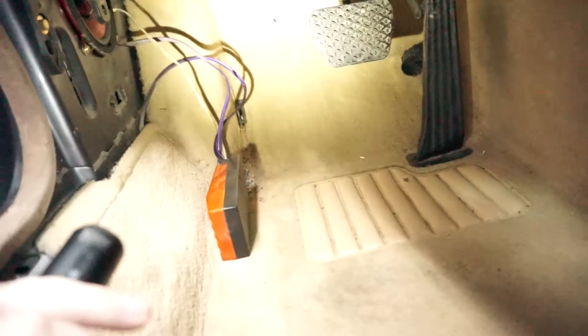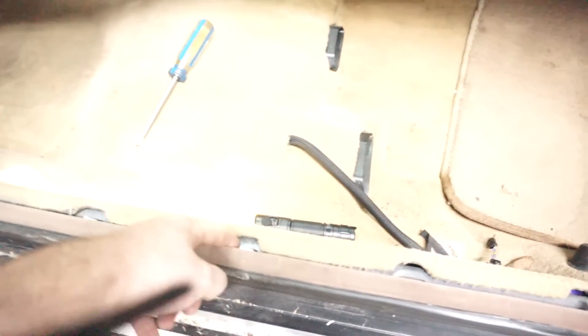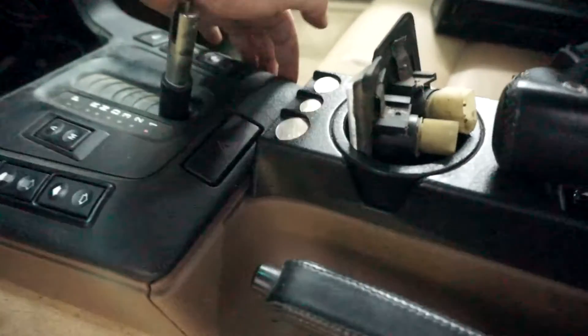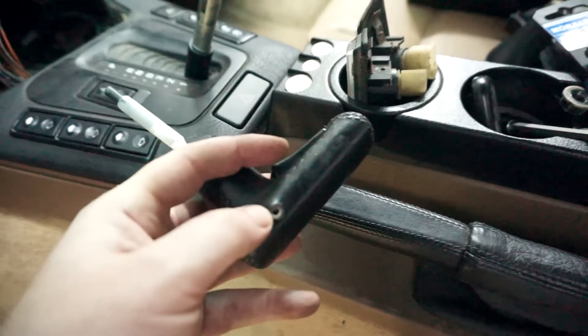Now I get to get on my back with a flashlight and start trying to take the stuff apart. I'm making solid progress — I got the under panel off, kick panel off, the side piece is off. This car has been apart so many times some of it's broken. The panel slides forward and then just comes right off these clips. When you take your kick panel off, you have to remove the hood release and it just slides back, giving you room to pull the panel off. The shifter has a set screw in the top right here — you back that out and it just pops off.